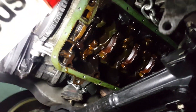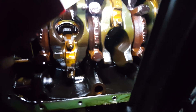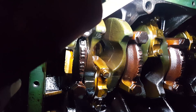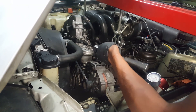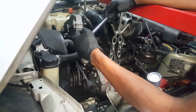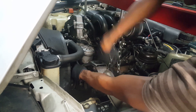I decided to jump out of gimbal mode really quickly just so I can give you guys a better view. As you can see up there, there are the pistons and connecting rod. The cylinder walls actually look perfect. Now what I'm going to do is start working on pulling off the alternator so that I can get to the oil filter base and replace that gasket — again, just doing preventative maintenance because I don't need any oil leaks on the car.